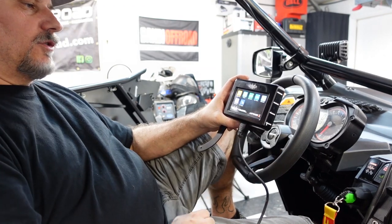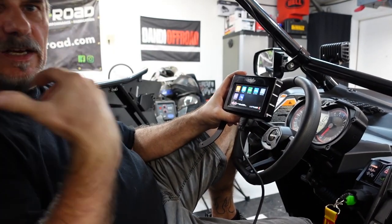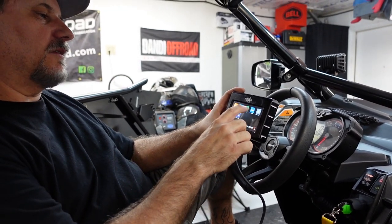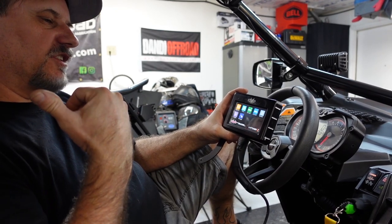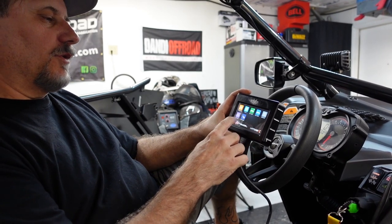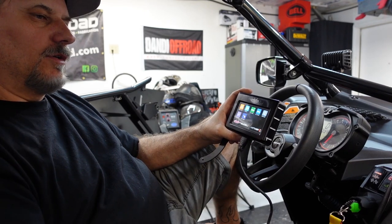So that's one thing — we need to probably adjust that. We'll check it again. We need to disconnect it to really check it. It's kind of hard to get right. But I have a feeling that that's not it. I have a feeling if we disconnect it, it's probably closer to 11. And I also think that this is potentially a boost leak. So we're going to find out.